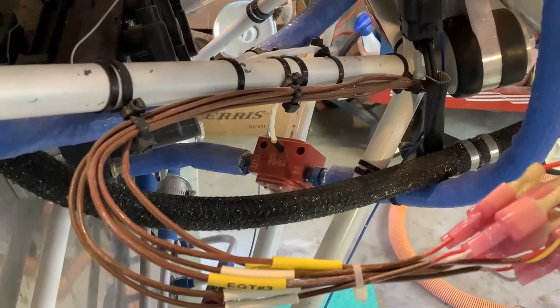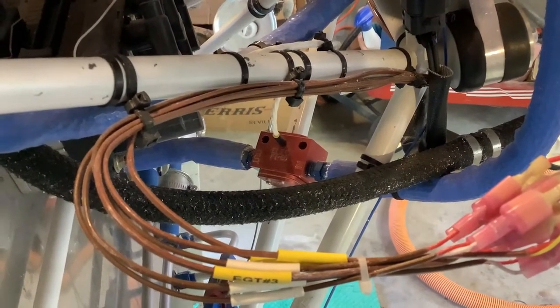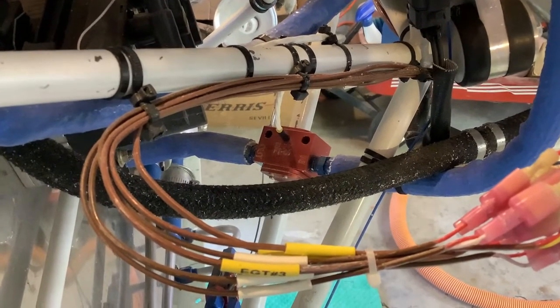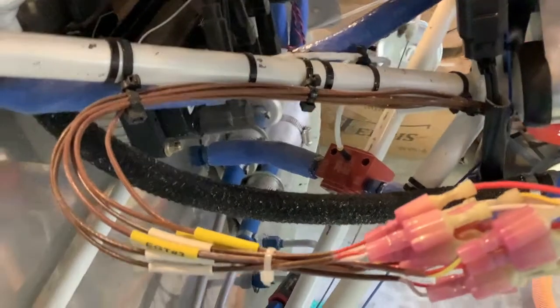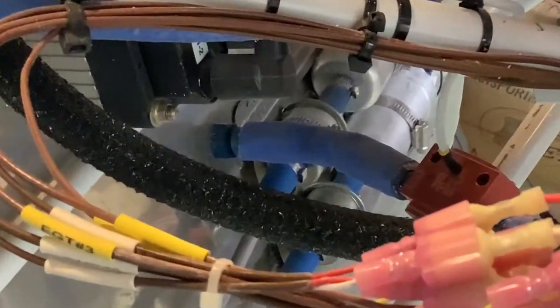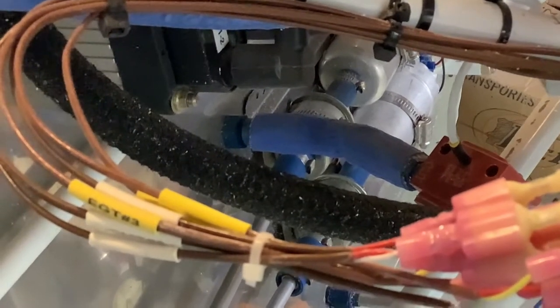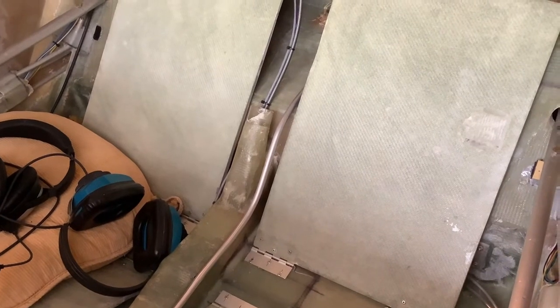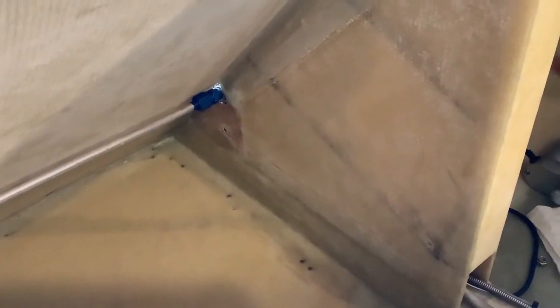The second red cube is on the return from the fuel injectors — fuel that is not burned returns back through the firewall and goes back to the selector valve up front. So this return line from the firewall goes back down through the center console, and you've got the regular fuel lines called out in the plans also going to that selector valve.